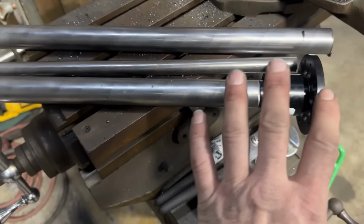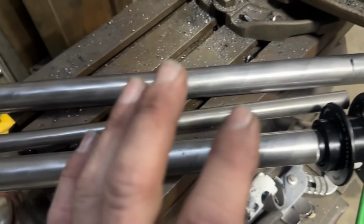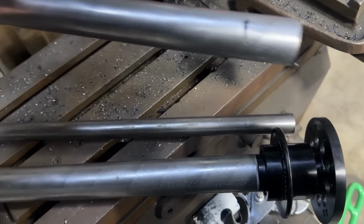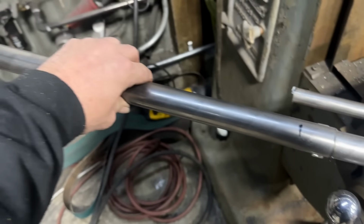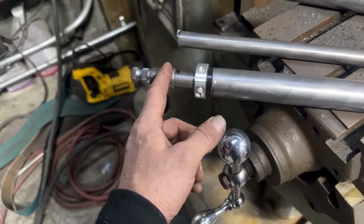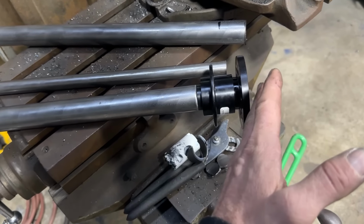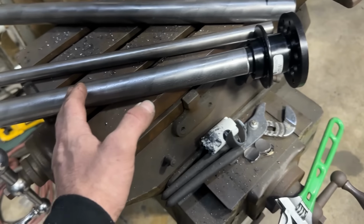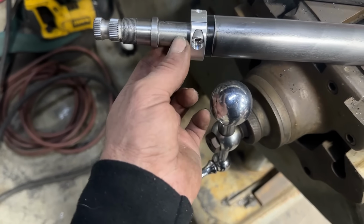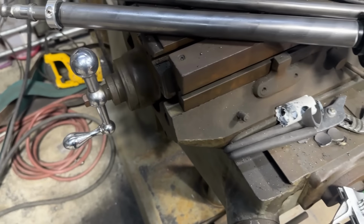Alright, so now you can see my column is made. The Motion Raceworks column kit is pretty sweet. So this is the steering shaft. This was the length of the column, so however long it needed to be. From the face of the U-joint to where the steering wheel needed to be was 19 and a half. So I measured that out and cut my tube accordingly. The inner tube, I cut to the length and then slid in my joint. And that's what we came up with.